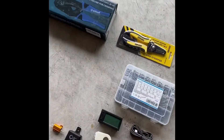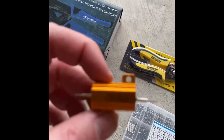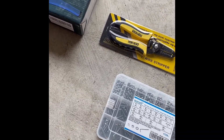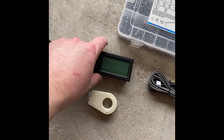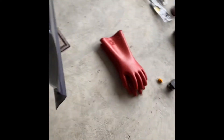The other components I'm going to be using: the inverter is so big it'll trip with a capacitor, so we need a relay — we're going to use this 200-amp relay. We're going to wire it using this resistor so that it slow-charges the capacitors on that inverter so it doesn't hurt it. We're going to use this hall-effect sensor to detect how much real-time power usage we're drawing.